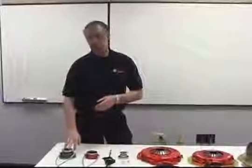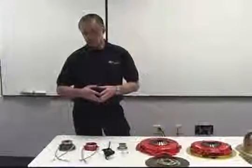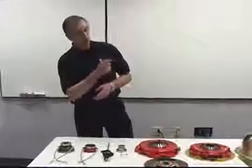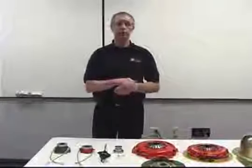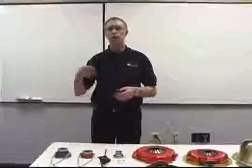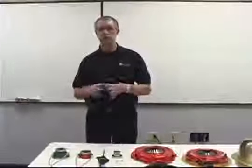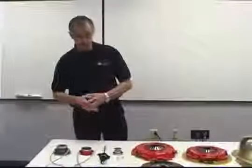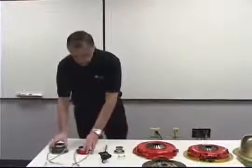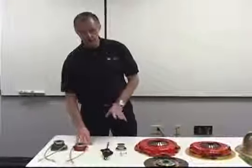That's a lot of work to put this on, trial fit it, send it back, change the piston. So if you'll just make the measurement from the back face of the bell housing to the tip of the fingers before you order it, and then call in, we can actually tell you how to order the bearing with the right length piston. So it's plug and play when you get it. You don't have to do any of this measuring and stuff. So this is one of our best-selling products, our hydraulic bearings. We sell lots and lots of these.